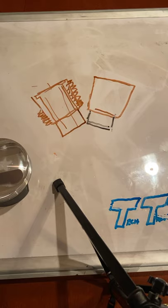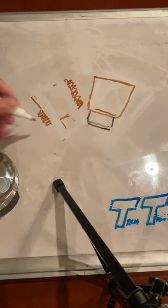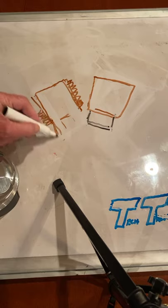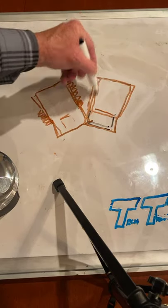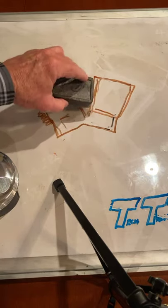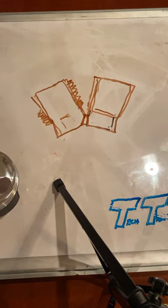But anyway, when you bore out the cylinder like our Milwaukee 8s, and you put bigger cylinders in them, we get all the way over against the aluminum here and all the way over here. And these are bigger liners. A lot of folks don't know this because we don't get to see inside the engines unless you're a tech. If you're not a tech guy or a real engine guy, you don't know this. But these cylinder sleeves hit each other. So we have to put a notch in the cylinder so that the cylinders don't hit each other.